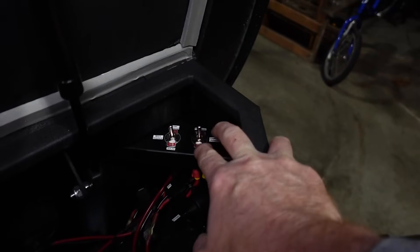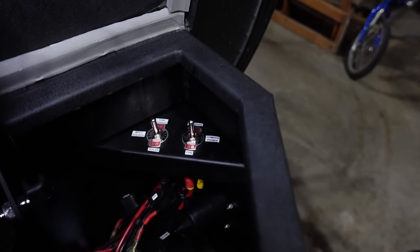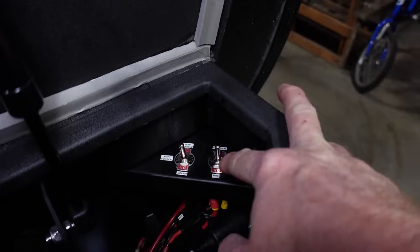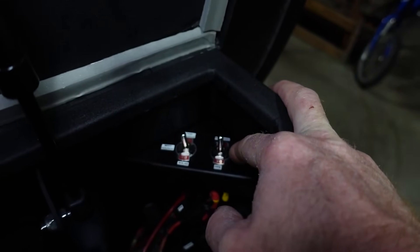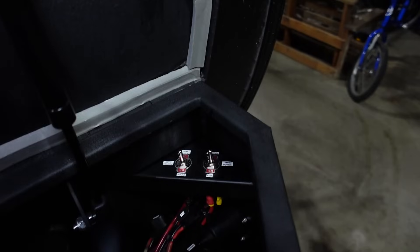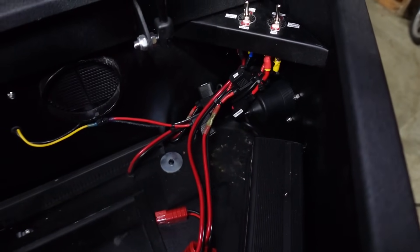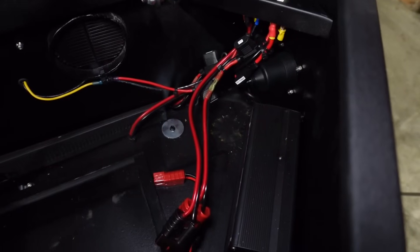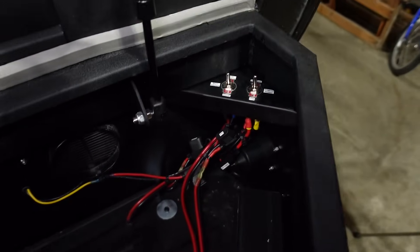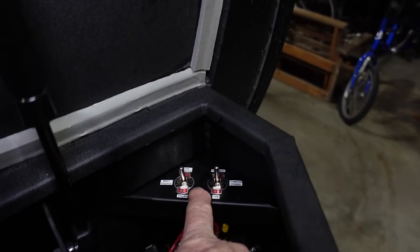The strap actually came with the power station — it's a very nice strap with a clasp that locks it in place so it can't go anywhere. Inside the box I made a small shelf in the corner out of sheet metal. I only have two switches that control the camper. The power station itself has a master switch, and then I use three-position 30 amp toggle switches to operate the power needs of the camper. Everything is wired with 10 gauge wire and 20 amp fuses.